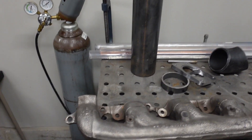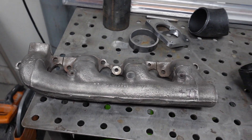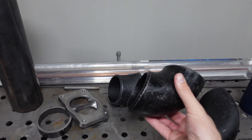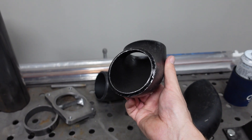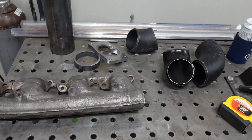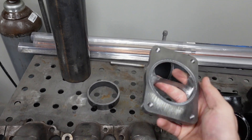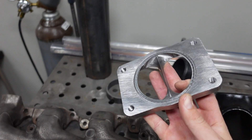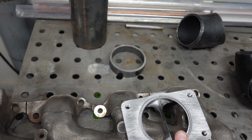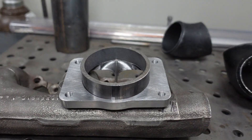Here's what we're going to use. This is the exhaust manifold you've already seen, and since you've seen it last I chopped off the end of the flange and wire-wheeled it to clean it up to make welding easier. The parts I was waiting on — this is 3-inch Schedule 40 mild steel weld pipe. This stuff is real heavy-duty with a really thick wall, right at a quarter of an inch, so I know it'll work well in a high-temperature, high-stress application like a turbo manifold. The flange that the turbo is going to connect to is a T6 flange. It's got a nice divider for a twin-scroll exhaust housing, which I am going to be running, and a pocket machined in to accept a section of 3-inch Schedule 40 pipe so it nicely registers in there for good fit-up and welding.